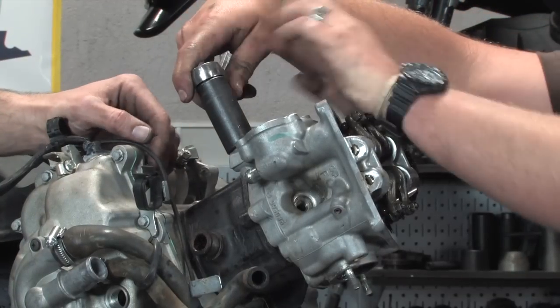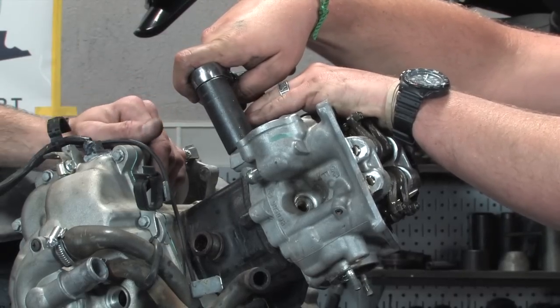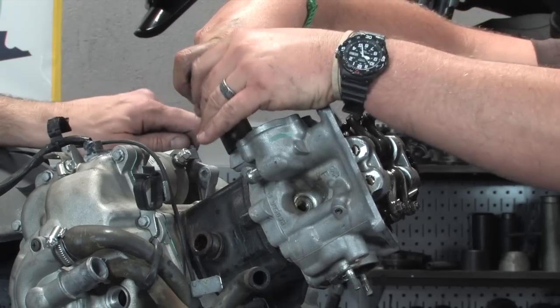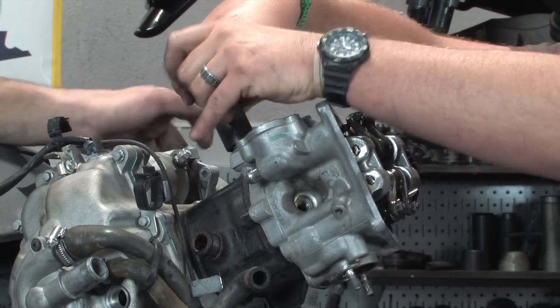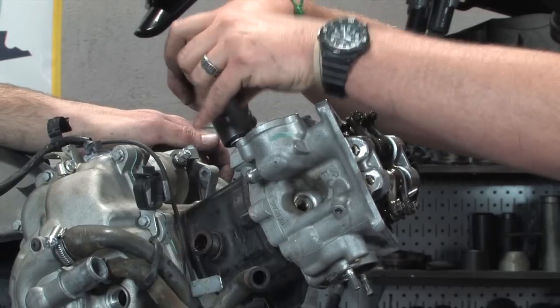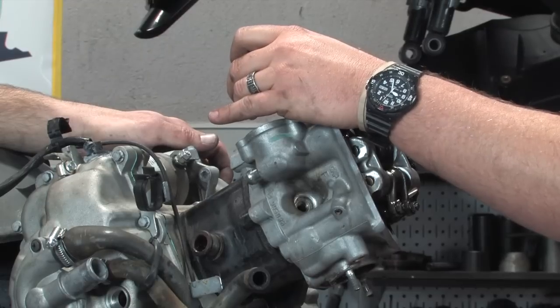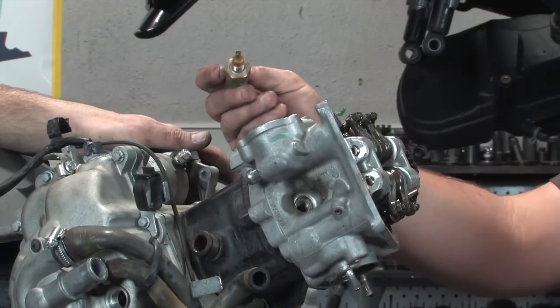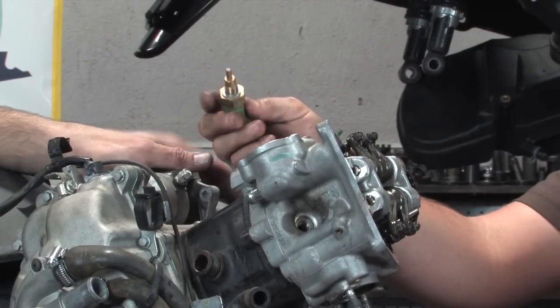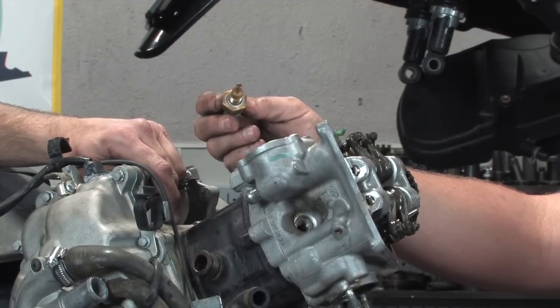And if you look at my coolant flush video, it covers how to correctly bleed the coolant bleeder system found on these 250 and 300 motors. The long and short of it is bleeding the cooling system is an absolutely critical step when it comes to rebuilding these motors, wouldn't you say, Robot? Yep. On the 200s, a lot of times you physically want to disconnect the upper radiator hose to allow the air to come out.